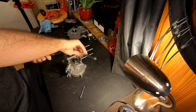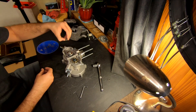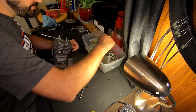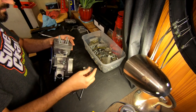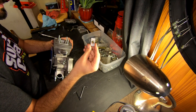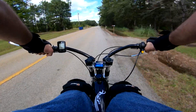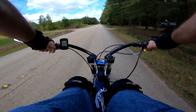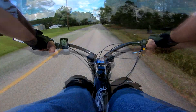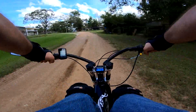They even installed the crankcase seals properly this time, which has been a big headache throughout motorized bike kits for a long time. During the unboxing in our last episode, you'll note that we only had two minor complaints: the defective trigger lock clutch lever, which I wish they would either fix or move away from, and the slant on the chain tensioner still moving towards the engine instead of the sprocket. Those are the only two updates I would recommend for this kit, but those are small gripes in the grand scheme of things, which is why this stays in my number one top motor for new and experienced builders. As you can see from our previous tests, the stock motor has no issues reaching just above 30 miles an hour — that's with the 36 tooth sprocket on 26 inch wheels. I would recommend staying with the 44 tooth for stop and go traffic or city travel. Your top speed would drop a bit lower, but in stop and go conditions or if you have to deal with any hills, you'll be thankful you stuck with the larger sprocket.